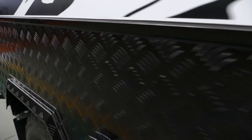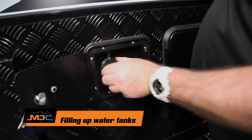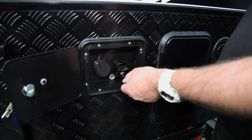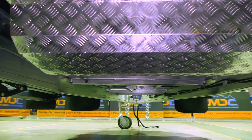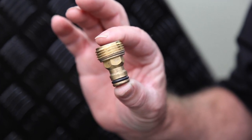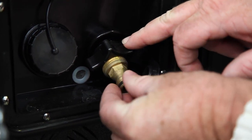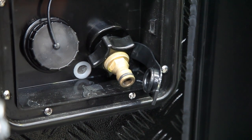On your Forbes 13 rear driver's side, you have filling points for your water. On the left-hand side is the filling point for your water tank; on the right-hand side is mains water pressure. Just below that you have a breather. When filling your tanks, make sure you buy food-grade hose so you don't have that tinge in it. If you're going to mains water pressure, it's a three-quarter inch BSP. Nilex and NETA make that product — it's what will fit on here and work well.